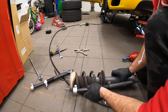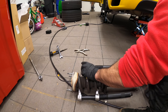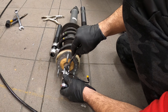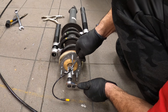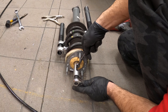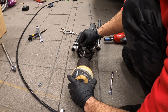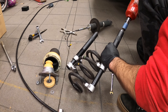With the shock out, let's compress the springs using spring compressors — I'm going to link them for you in the description. Next, we're going to undo this nut using a 19 millimeter strut tool. You put the wire inside, and the idea is to hold the middle with a 9 millimeter — or in my case 11-32 — while you undo the outside. It might take you a while. With the nut loose, you can take it out and put it in a safe place. You can take out the top piece as well, and then take the spring out and decompress it.